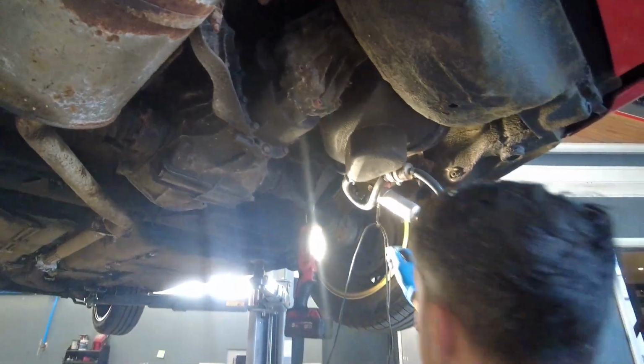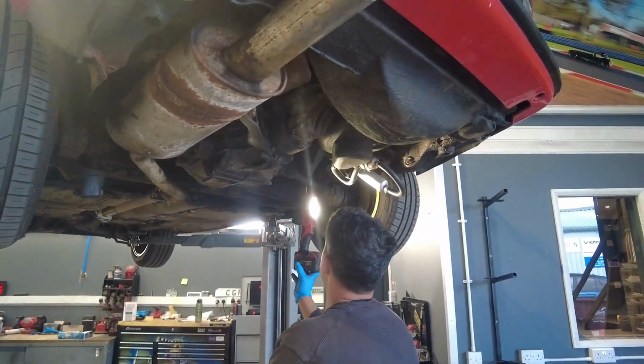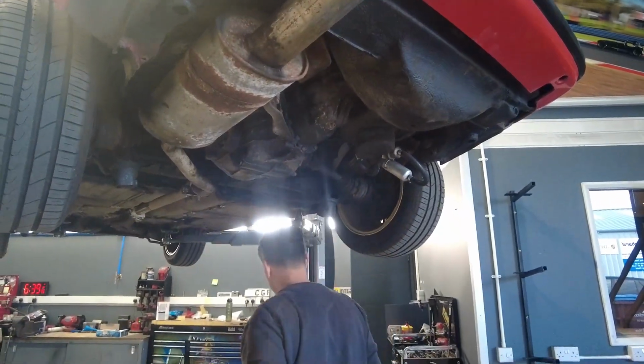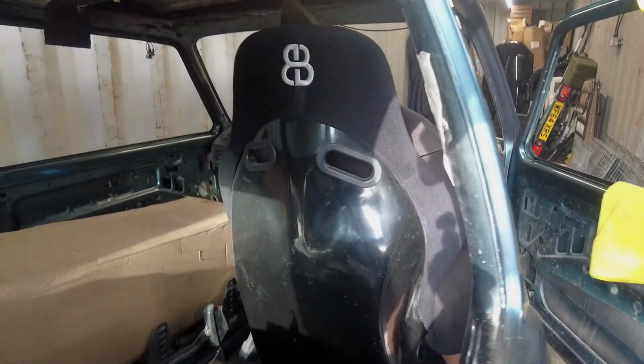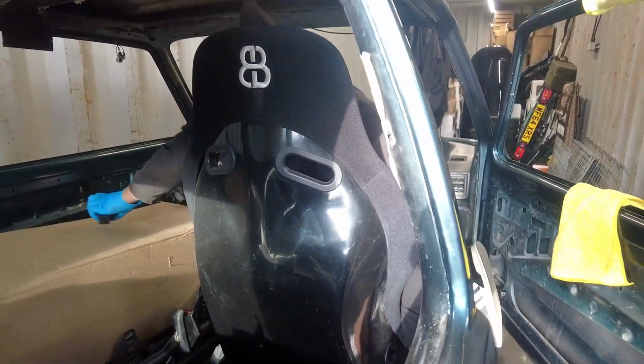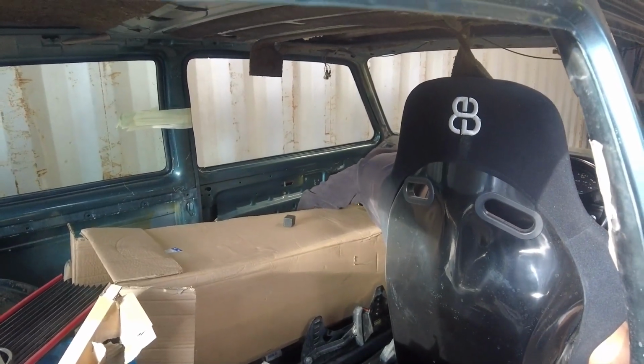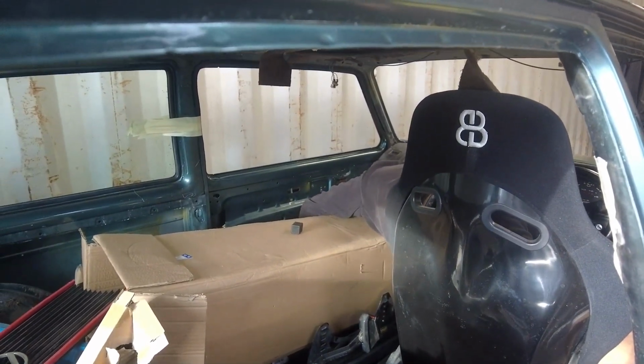So, what's next, Charles? We're going to check the fuel pump relay. And if need be, we can bridge it, just to prove that it is that. Charlie's now looking at the fuel pump relay because we are not getting a live sent to the fuel pump. So we need to work out why the relay isn't actually sending anything. That's next port of call. Charlie's now having a look inside his Mark 1 GTI because we believe that it might have the same fuel pump relay. It actually has the same fuel system.